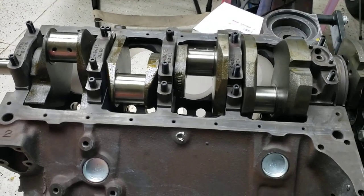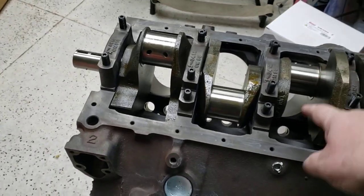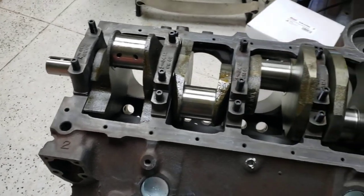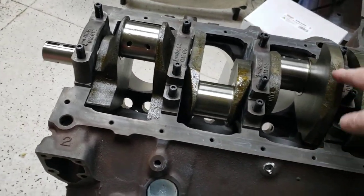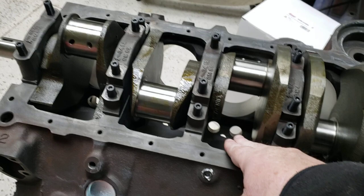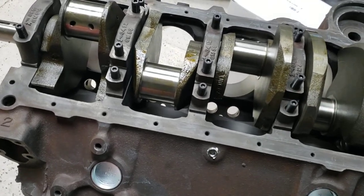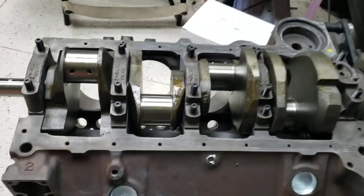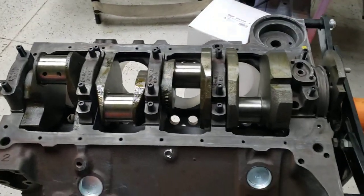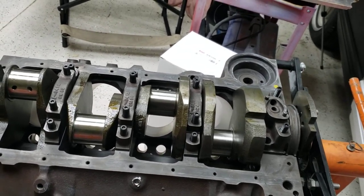That kind of gives you the gist of what it is — the stroke, or the pistons move farther up and down in the cylinders. So you've got to be careful of your camshaft because this thing swings so wide. If you get too high of a lift camshaft, they'll actually run into each other. So there's a whole bunch of stuff you've got to be careful of when you build one of these. But when you build one of them, they are a lot of fun. And you can get them as an engine kit from most of the builders. That kind of gives you an explanation of the 383 stroker.